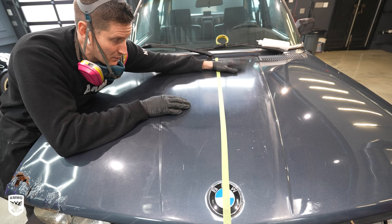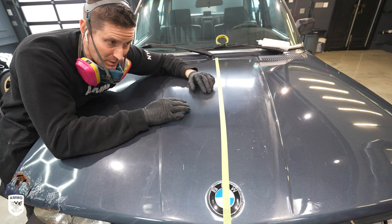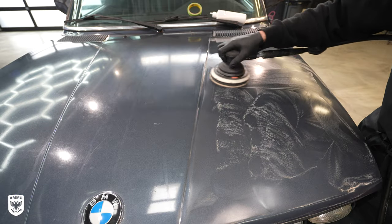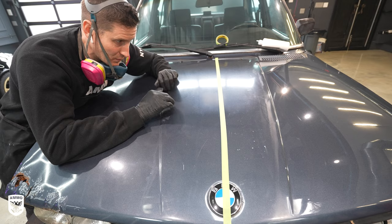You can probably use 1000, then 1500, then 2000, then 3000. I'm not doing that here — it's basically a piece of scrap metal and it worked. I'm using 1500 and 3000 on the Rupes six-inch Scorpio — I think it's called the Scorpio — it's a palm sander. Unbelievable. I'll show you how to go through those steps right now and walk you through the whole thing.